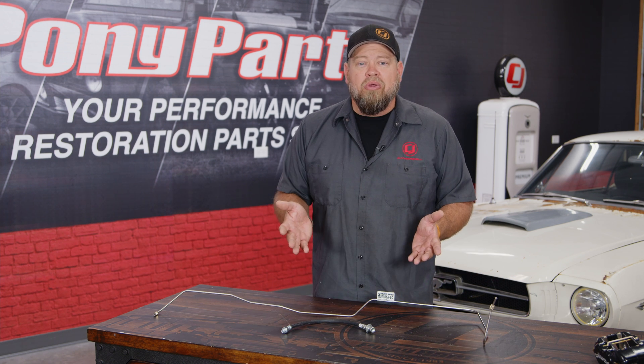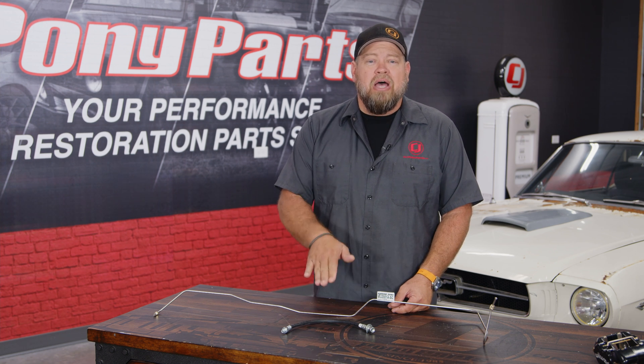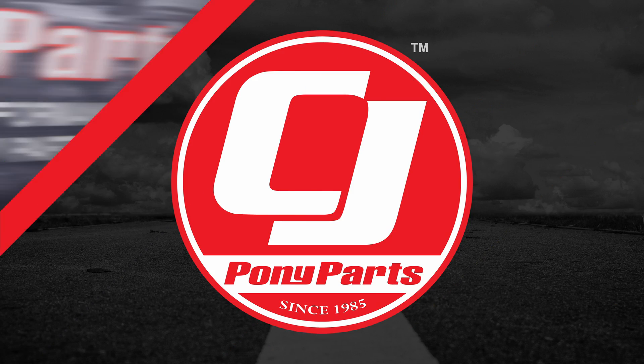The reason the hard line is metal is to protect it. If you had rubber hoses on the bottom of your car, the rubber can actually expand, and rubber lines are a lot less consistent, less safe, and more prone to damage. When it gets to the hoses, the rubber line is acceptable because it's up out of the way. But an excellent upgrade for your car is a braided steel brake line instead of the rubber hose, as they will be stronger and last longer. Once your brake fluid is pushed through the master cylinder, goes through the hard lines and then the brake hose, the last stop is the caliper. This is why you bleed the brakes at the caliper — it's the end of the line for the fluid and that's where you get the air out.